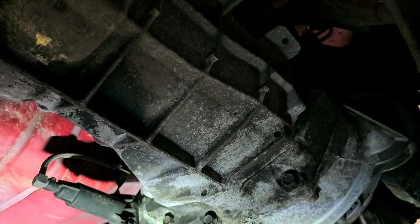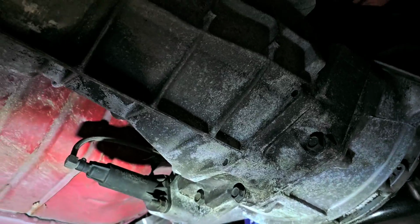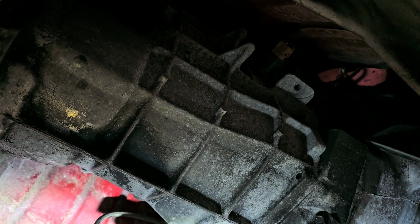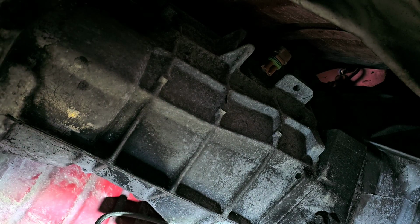All right. So there is an electrical connector right there. You can see that. Just got to reach up and disconnect that. Let me focus on that. And it should be just a matter of grabbing the tab on the other side and releasing it. There it goes. I had actually already cut this harness. It doesn't really matter. Some of you are going to say, oh, why'd you cut the harness? Because I don't care on this car, because it's not getting that same harness. All right. And there's a connector up where the shifter is.